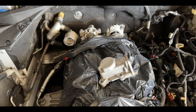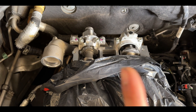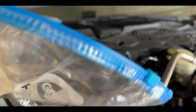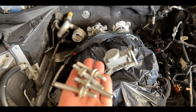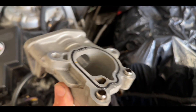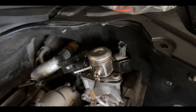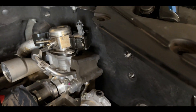Today's task is getting the fuel pump bracket, the high pressure fuel pump, and the vacuum pump back onto the rear section. You also have the fuel hose that needs to go back on — one leads to the high pressure fuel pump and the other goes to your injectors, so make sure you don't mix up that hose. Now we're putting the high pressure fuel pump on. There's a little insulator that goes on there, and we put the pipe on.